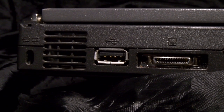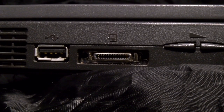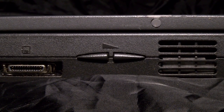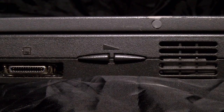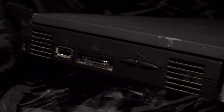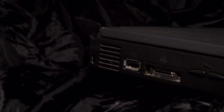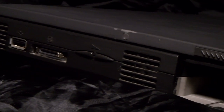There is a single USB 1.1 port, an interface for an external floppy drive, and volume control buttons. Having up and down buttons instead of a knob was quite common when this laptop was made, and even some desktop CD-ROM drives did it. I'm fairly certain Philips made some like that, but the laser assembly seemed to go weak fairly fast in most of the ones I saw.